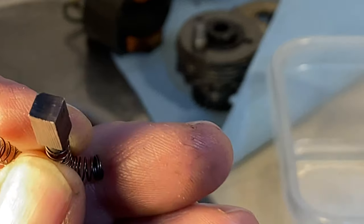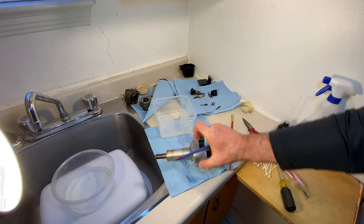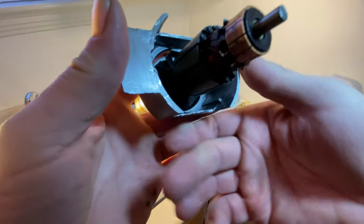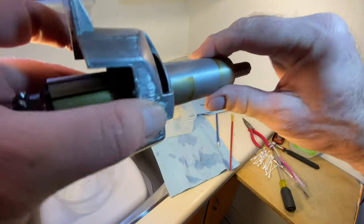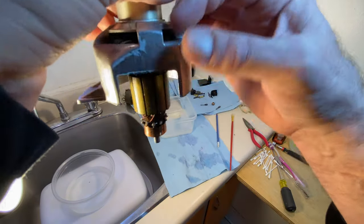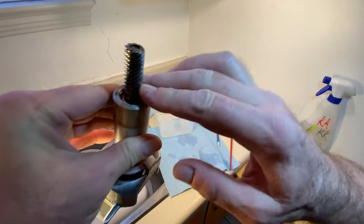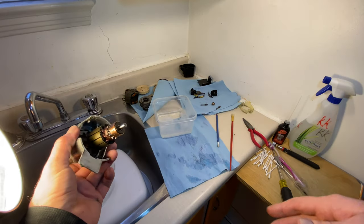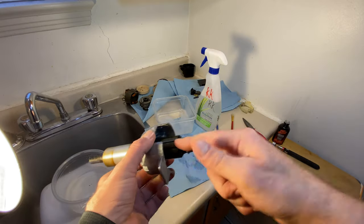There's a bit of a view of them. They're clean now and what we're going to do is start cleaning this. First we're going to spray crud cutter all over it, in here, on here. We're always going to hold the motor up this way when spraying, because there's a bearing behind the fan and another bearing there, so we're going to be very gentle. There's our commutator.